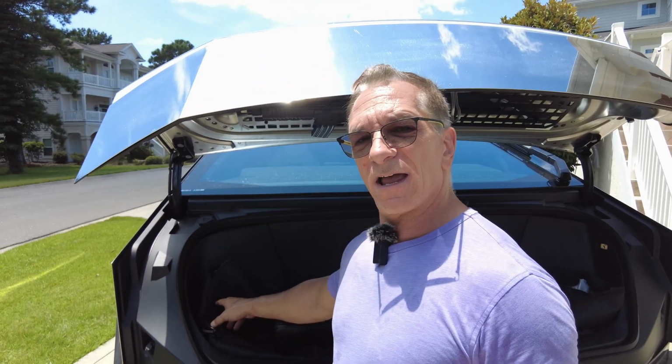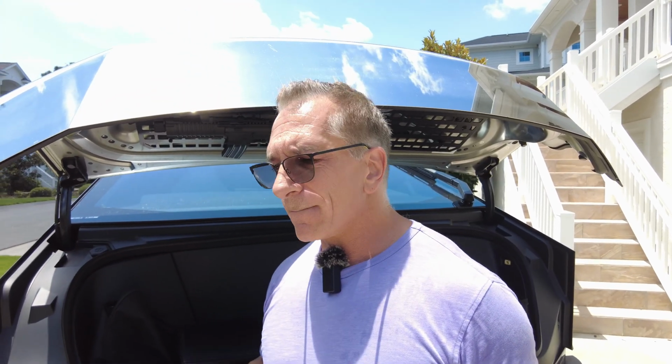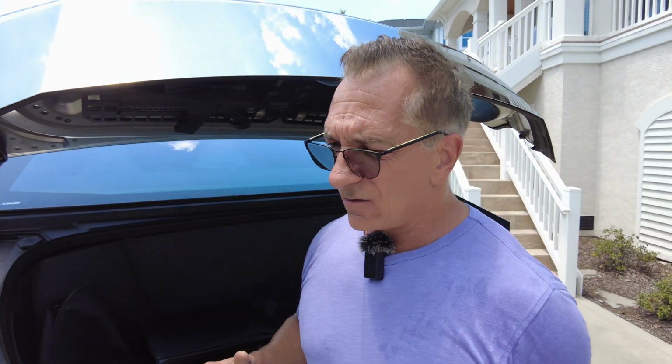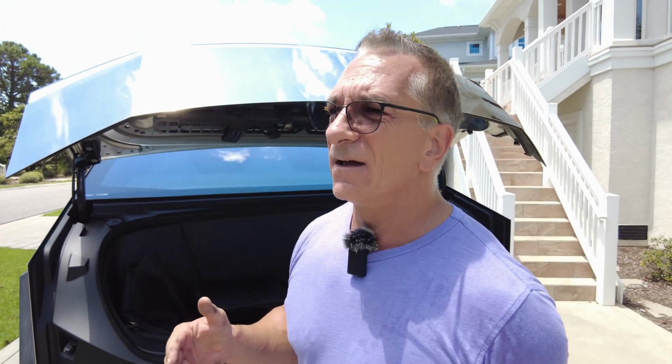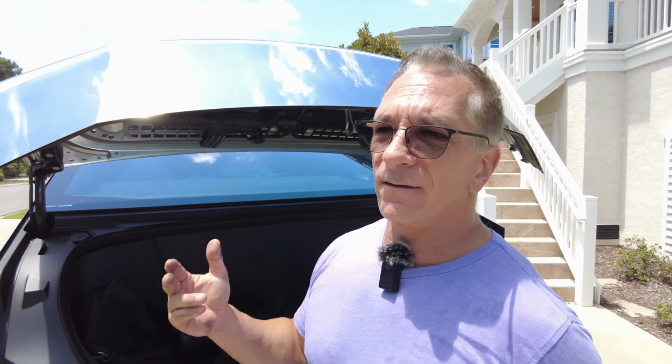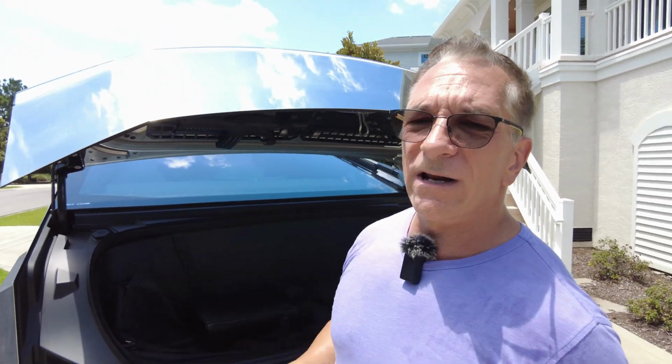Over here on the passenger side, you're gonna see 3 wires. They might all be bundled together, so you have to strip them back, because usually they tape them up. There's actually 3 wires, 2 of them have 2 colors. The one that's got the red on it is obviously your positive, and then there's another one that is brown and blue or something like that, and it's a brown, that's your ground, okay? Brown ground, red hot.